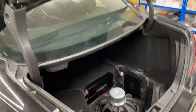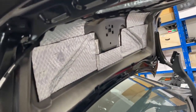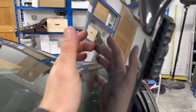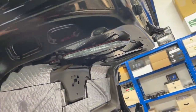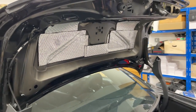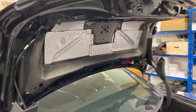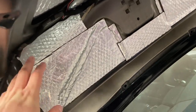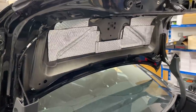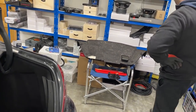This needs a bit of footage as well. Obviously, because we have that 15 in the boot, that's going to have some pressure on the tailgate, so that needs attention. But there's no way to get into the inside of it. There's not a deep cavity, but the outer skin cannot be deadened. So we added weight from the inside, and on the top, at least behind the ratchet plate, you can get to the outside, but not there. So not every car ticks all the boxes when it comes to pure audio. It wasn't designed for that. It's great when you can get into the inner skin and deaden it, but not here. We will see how much it's going to buzz and rattle. As long as we can't hear it inside of the car while listening to music, it's fine. And we will isolate that panel. That carpet needs isolating.